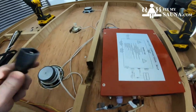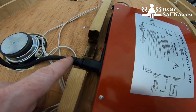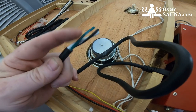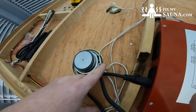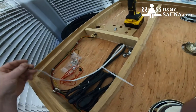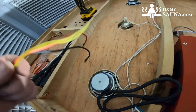So I have my first heater cable here, which I'm going to connect right in here just like that. This is our jumper cable. Remember, we talked about needing up to six jumper cables but on this one we only need about two. The jumper cable comes over — it's already pre-stripped, so sometimes I'd cut it to look cleaner but you don't really have to. I'll get some zip ties afterwards and zip tie it over so you can't see it. This is our heater power cable that runs all the way over here — your red, black, and ground.